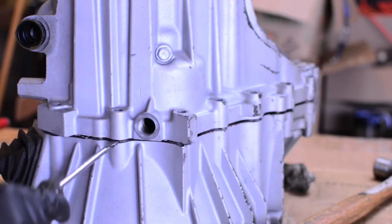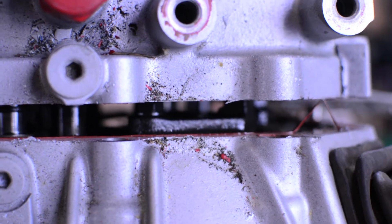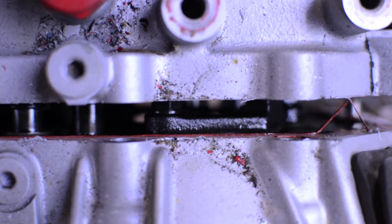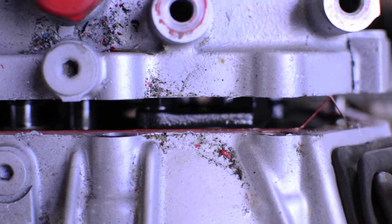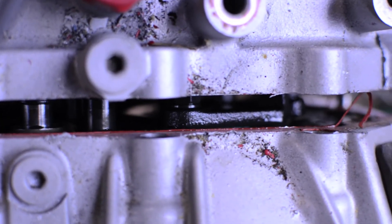It's pretty much loose — this is where it gets tricky. We have to lift the transmission case up while unbolting the reverse idler arm. I'm going to try to prop this thing up and then reach in there. The reverse idler arm is right there — that's what's stopping the case from coming apart. I'm going to use some flat gear wrenches and hopefully we are going to split this case right now.